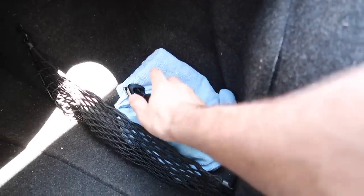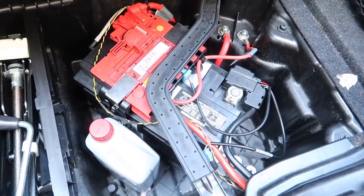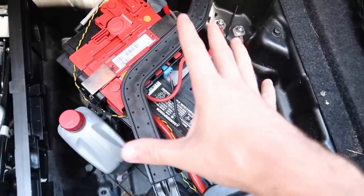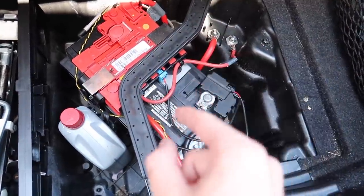Normally on the E90s the battery's over here, but on this car the battery's somewhere down here. Let's go ahead and pop this sucker up. You might have to remove some trunk carpet, but the battery's right there — we're gonna have to get that battery out. It is completely toast. We'll do a full time-lapse, get this battery out, take it down to Costco, get a new one, and all the computers in this car should be functioning A1 once this battery's been replaced.